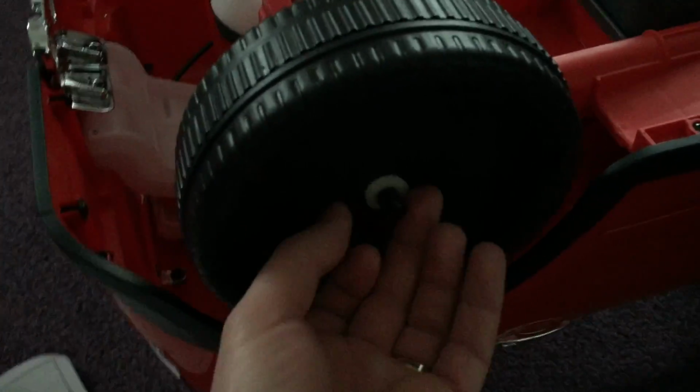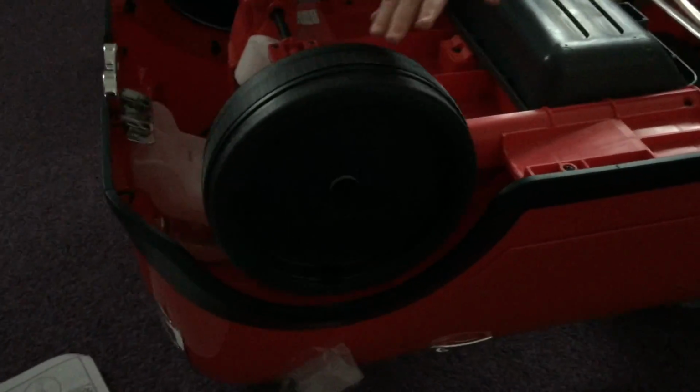Next, you have to find your washer, and you get a little bit of Vaseline again. Just lube it up. I like it. Right, you get the plastic washer and place it on top of the wheel hub, find the metal one, wherever it is, there, put it over the top. And then your little pin, you might need a screwdriver, you might not, but you put it in the hole. So now I just put that pin on, it just literally clips over the top, and then lovely. So obviously repeat the same on the other side, and I'll show you again.